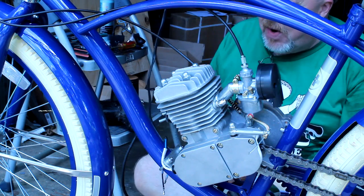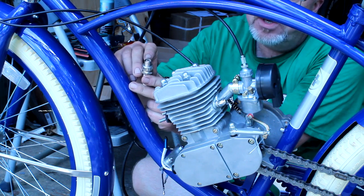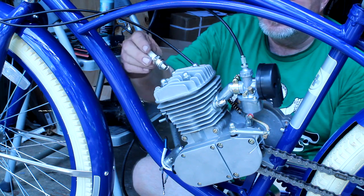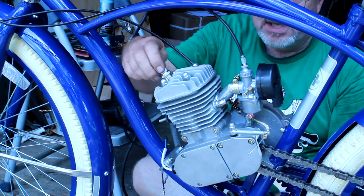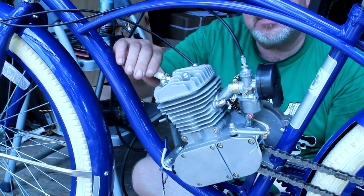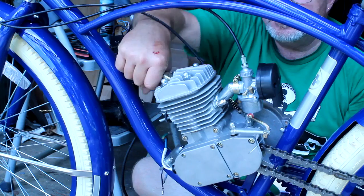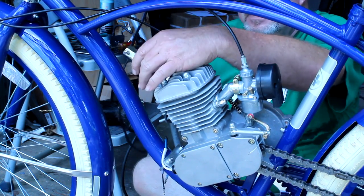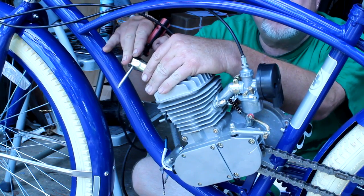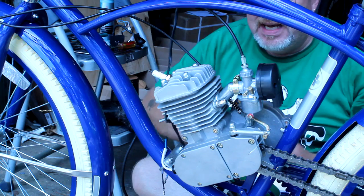We're ready to install the spark plug. The spark plug has a gap — you want to make sure that your gap is a little bit thicker than a matchbook cover and not quite as thick as a credit card. Put your spark plug into the cylinder and slowly tighten it up. Be very careful you do not want to cross-thread it and strip the threads in the head. It should turn freely. Once you get it snug by hand, go ahead and tighten it up just a little bit — not even a quarter of a turn. You just want it snug but not real tight, because this is an aluminum head and you'll strip the threads fairly easily.